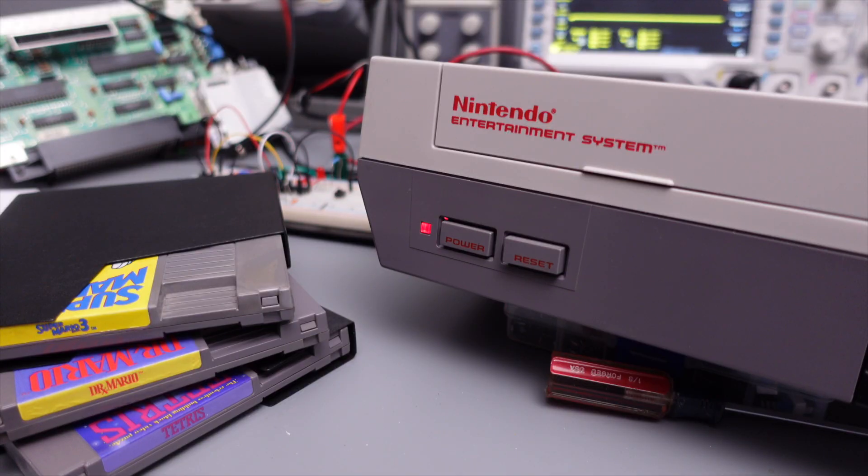If you played games on a front-loading NES, then it's extremely likely that you've actually seen this before. Ever slide a game in and turn the power on only to have the console just sit there and blink at you? That's the CIC lockout chip on the NES entering and executing that failure loop. Most of the time, this is caused by a faulty electrical connection between the lock and the key, by way of a corroded pad on the game's PCB or a loose cartridge connector.